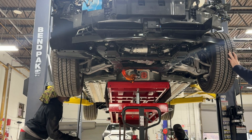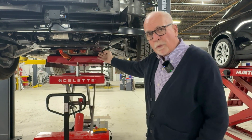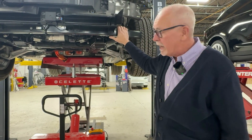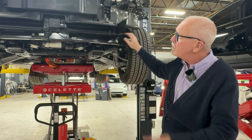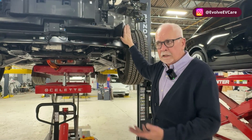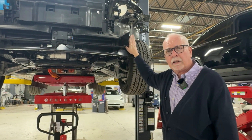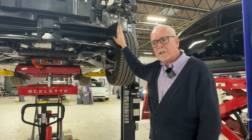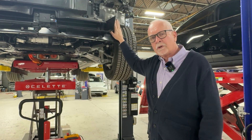The battery's aligned and going back in now. We'll grab the bolts, fasten, and torque everything down, then reattach all the high voltage and low voltage components as well as the thermal management system. We'll have to fill and purge the battery to get any air out before moving to the next step — sending it forward in our process for paintwork and the rest of the collision repair. Just wanted to show you what the new Honda Prologue looks like with the HV battery out. Any questions, please leave comments below. Thank you for watching.